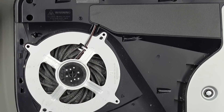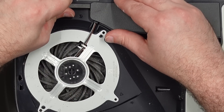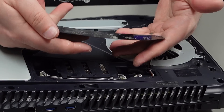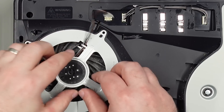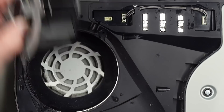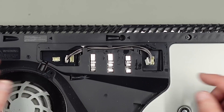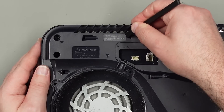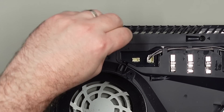The two screws that go in here are the same, but the other two are both different — the longer one goes up top, shorter one down below. That will allow us to take this grill off, but we still need to disconnect the fan, so we need to lift up this plastic cover. I'll use a pry tool and come in on the side and slowly lift this up — it's just stuck down by some adhesive. The easiest way to remove the connectors is to grab all three wires and pull upwards. We can also unplug these other connectors. Of course there's going to be a hidden screw under this warranty sticker, which will also need to come off — this thing is already out of warranty so we're not worried about that.